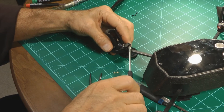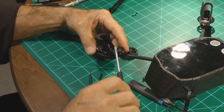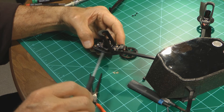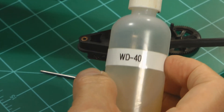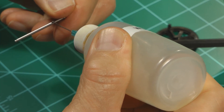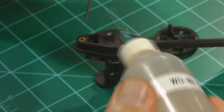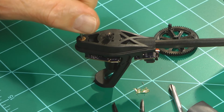We're back. I've attached the rear connector to the circuit board and have the circuit board screwed in to the arm and foot assembly. I've got some WD-40 — you don't want to use very much, that's for sure. So I take a little bit and just put it on the shaft, run it up and down the shaft, and make sure that the bearing surface is okay.